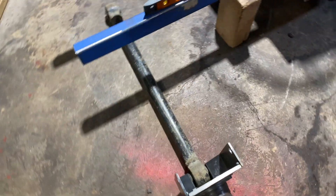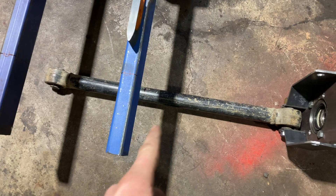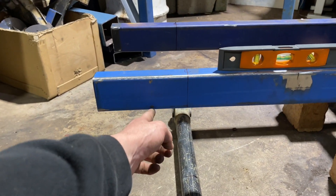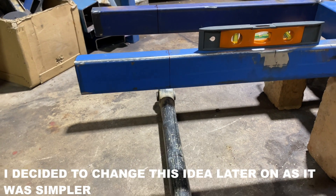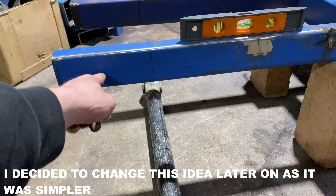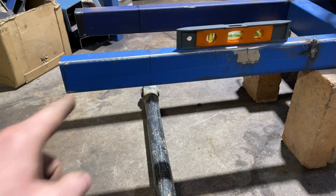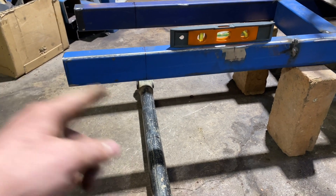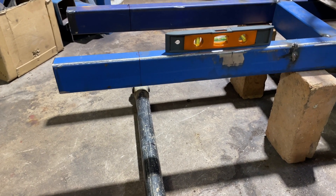Now what we're going to do is shorten up these bottom arms and bring those back. I'm thinking we'll just run down two simple pieces, possibly down here, and then run our CV axle through the centre of it. That way we can make up some top arm mounts and it'll be fairly simple. We'll use the same thick stuff as the frame to save on materials and then brace it all with that one-inch tubing we've got.